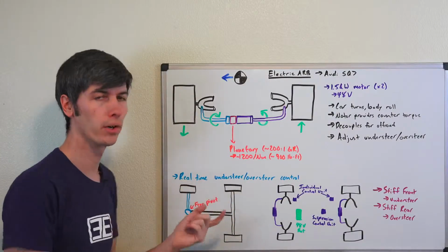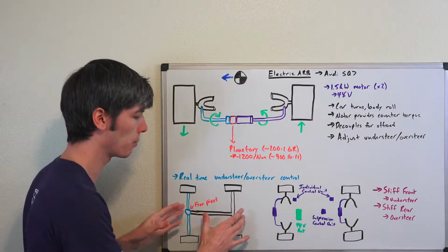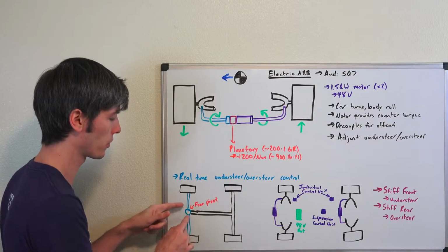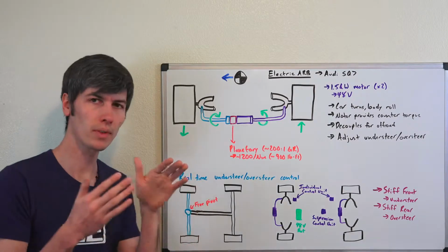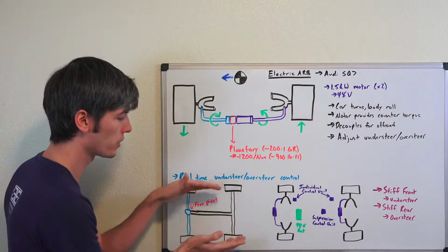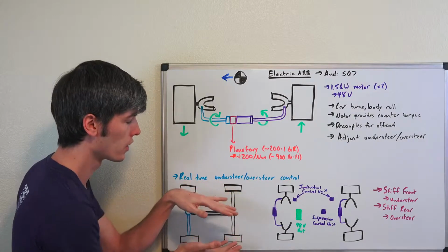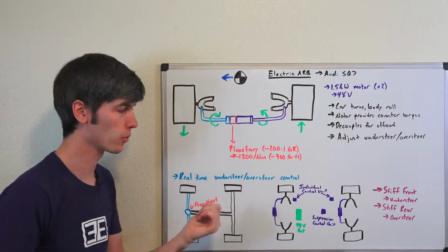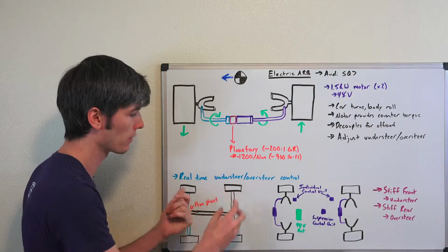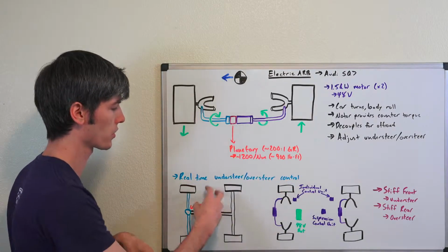You can't really change how much load transfer you're going to have there, but you can change which tire, front to rear, gets the majority of that load transfer, and partially that's based on how stiff your anti-roll bars are. So for example, if you had a front anti-roll bar which was infinitely stiff, and then you had a free pivoting rear axle, so it can simply rotate about that rear point, as you can imagine, as you go around a corner, all of that load's going to be transferring to that front left tire because it's rigid. So the car wants to lean, but it can't lean even though the rear pivots because the front is completely rigid. So you're going to have a lot of load transfer to that front left tire, and as a result, because you're not evenly distributing it between the front and the rear, it's going to start to understeer because this tire is going to be overloaded. So the front of the car is going to start pushing forward, it's going to start to lose grip.